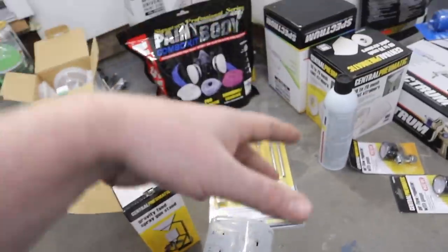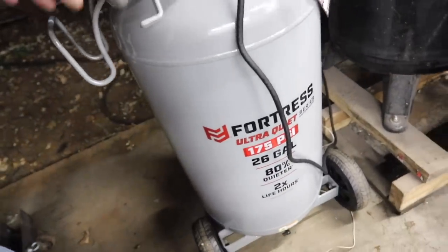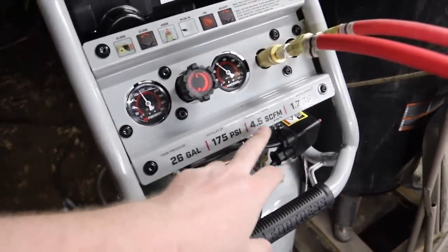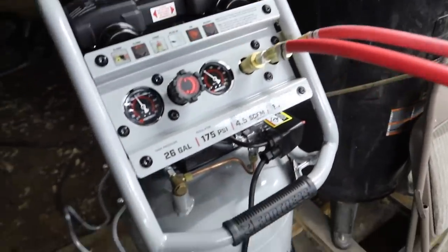It's super, super awesome — it makes paint jobs go by a lot faster when you can just chuck that stuff in the trash, clean your gun out, and you're done. They sent me so much stuff. Let me show you the air compressor — this is the new Fortress air compressor system that they sent out to us. It's like 26 gallons, really quiet, and it does 4.5 SCFM at 1.7 horsepower. This isn't enough on its own to do DIY automotive painting, but we tied it with our other air compressor and with the two combined we're overkilling it. Big thanks to Harbor Freight. I'll put some links to those new paint guns in the description. If you want to know the ins and outs of how to paint, watch some of the videos like the GTR painting process or the BMW 335i. Basically: clean everything very, very well, wax and grease remover, wet the floors, get the dust out of your situation — and then we're going for primer.